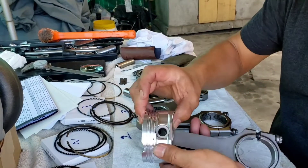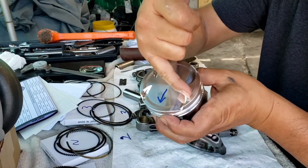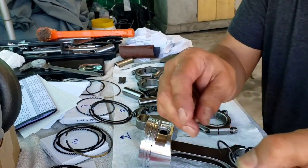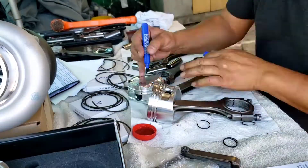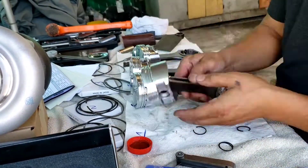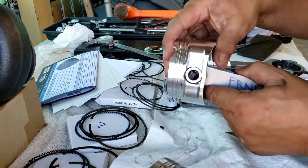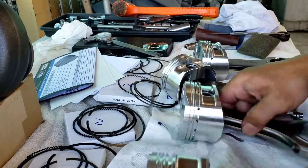One is in. The arrow indicates intake relief exhaust, and the front tabs are on the exhaust side, so I'm good to go there. Now I'll put this on again — start open and just push. You're gonna hear a click. Verify and make sure everything is in, push it in the groove. The last thing you want is this thing coming off on you.